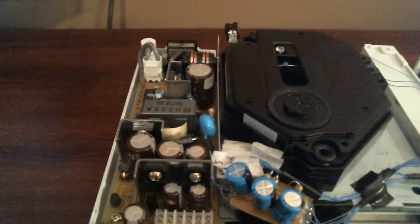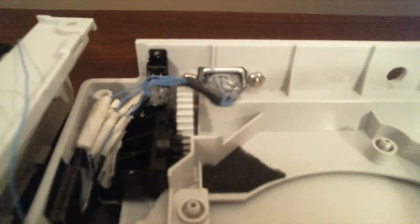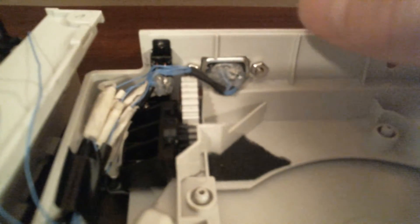Here is the female VGA port, and behind these blue wires is the switch — I hot glued this so there's nothing really touching; I hot glued everything. From the female VGA port run six wires: ground, red, green, blue, horizontal sync, and vertical sync.